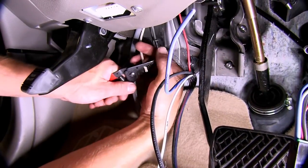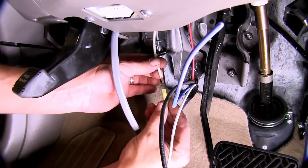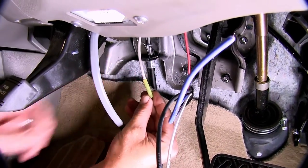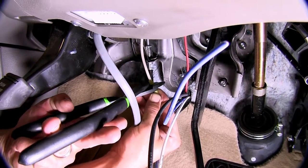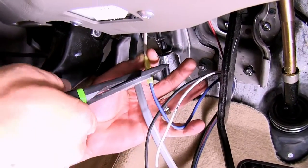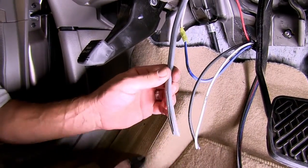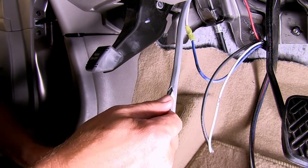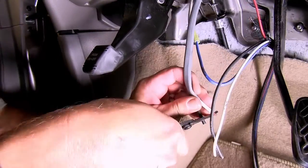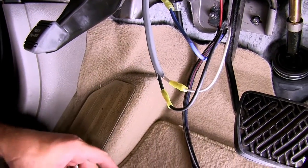Next, we'll take the blue wire from our brake controller pigtail and connect it with the white wire that we ran into the cabin of the vehicle. This white wire came from our 7-pole connector where we connected it to the blue wire coming from the 7-pole — this will be the power for our trailer braking. To connect the two, we'll cut off any excess wire, strip back both ends, and use the yellow butt connector provided with our install kit. We'll repeat the same process for the black and white wire from the brake controller pigtail and the black and white wire inside the gray duplex cable — matching them color for color, black to black, white to white, for power and ground for the brake controller.